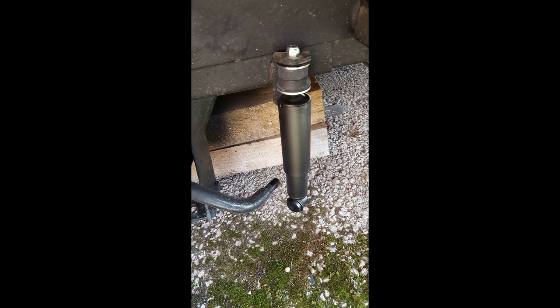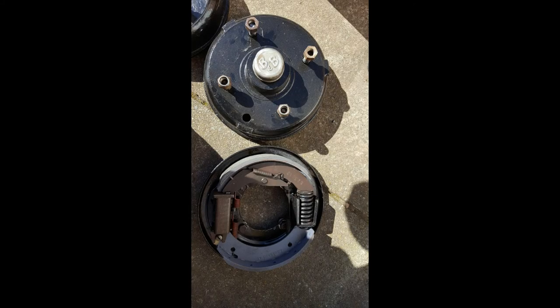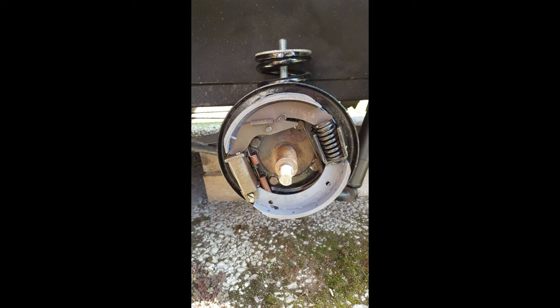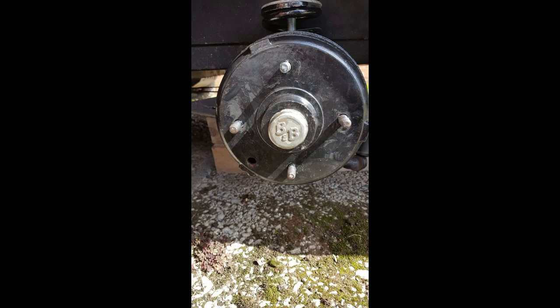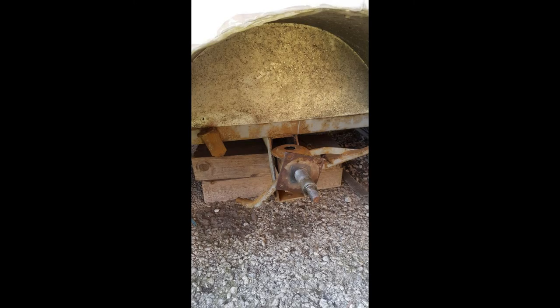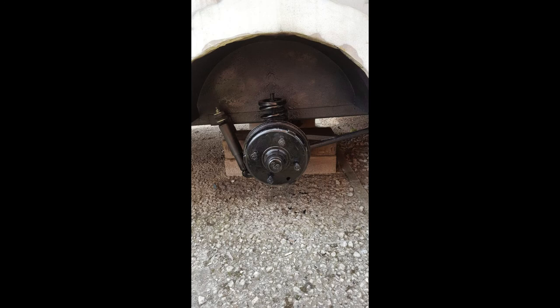Normal filler over the top, rubbed all that down ready for refitting. Shock absorbers: I struggled to find one, but I did find one that came off an old T4 VW camper van, which worked a treat. This is me rebuilding the hubs, fitting the springs back in place — new threaded bar, had to cut the old ones off. New shoes, everything else in place and the hub refitted. Certainly looks a lot better. So that's all back together ready for accepting wheels. Making a start on the other side: clean it off, rub it down, start Hammeriting the inside, then put the stone protection on.